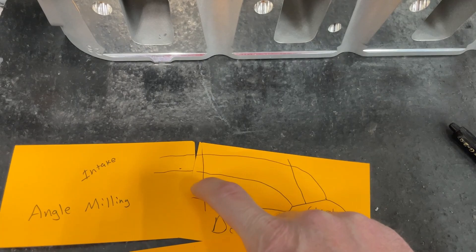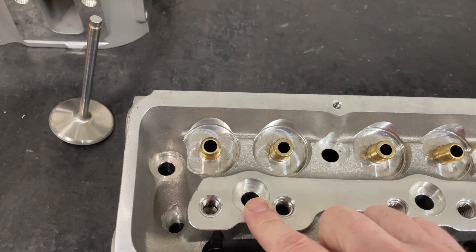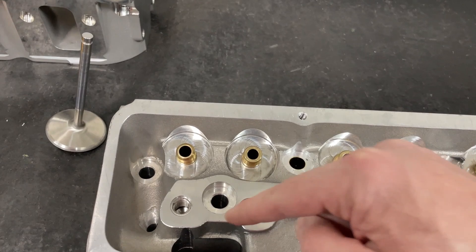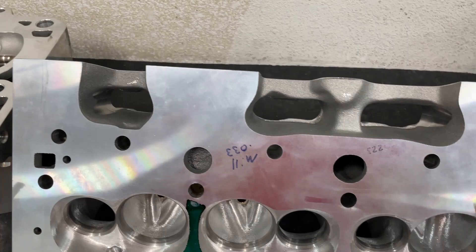The second issue is that the head bolt areas also have to be refaced. If you roll the head over, all the spots where the bolt holes are sitting are now tilted — they're no longer square with the top of the head bolt or nut. So you have to spot face each one, and in extreme cases those holes also have to be elongated because the stud won't even go through. Because of all this, angle milling is a multi-step process: mill the deck, recut the intake face, spot face the bolt holes, and sometimes elongate them.